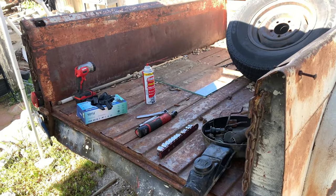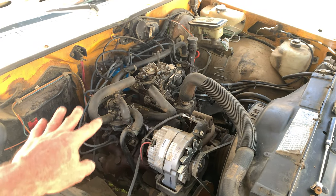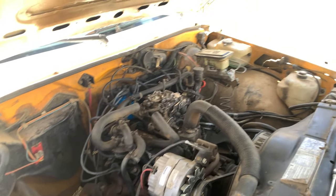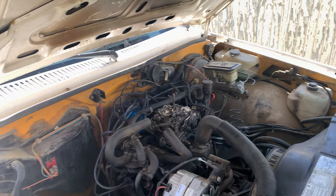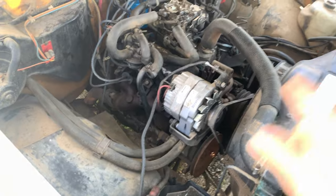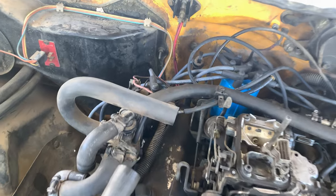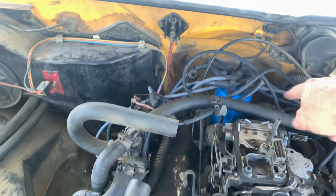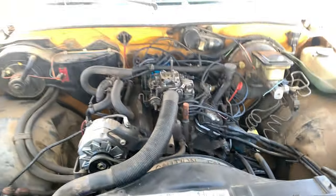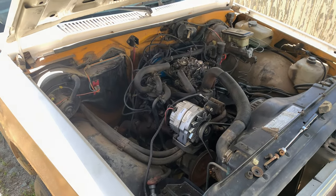And thankfully, we've got our new workbench. So what are we waiting on? We're still waiting on our little tree of EGR that comes out of the header. We're still waiting on the PCV and some other little things here and there, but we did get the new smog pump, and we got the new vacuum connection, which is supposed to go into the distributor with this little switch to activate the vacuum line. So hopefully I can get that all connected correctly.